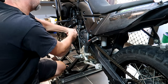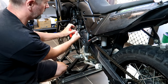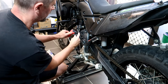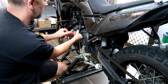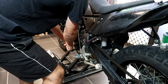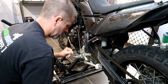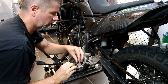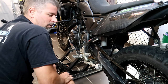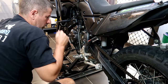If you guys saw on a ride last year, I broke one of the studs that holds the sprocket cover when the chain derailed - broke the stud right off the case. So that's one less bolt to undo anyway. Sprocket guard is off. That front sprocket's looking a little bit worn, but I reckon it's got another 5-10,000 Ks in it. But I've got the stuff here so I'm going to replace it.